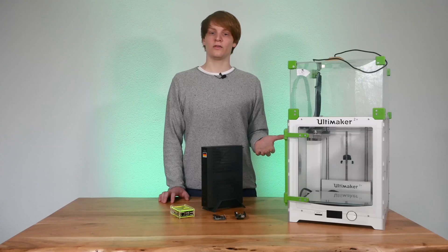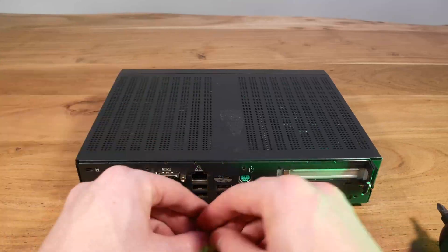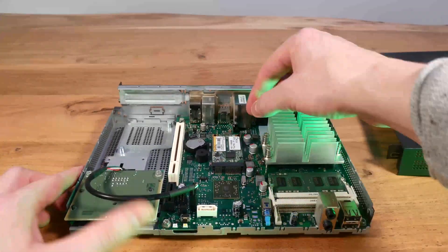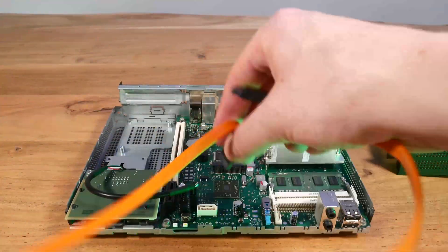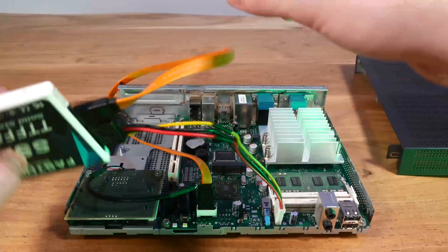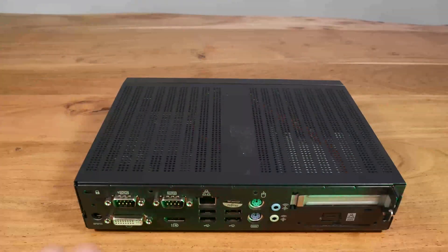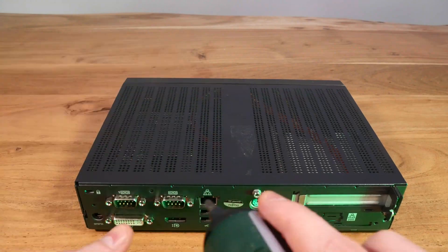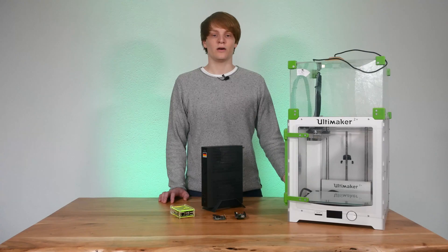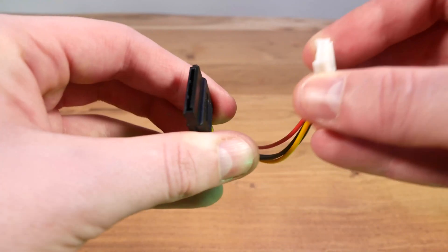How do you set this up? First, I needed to replace the mSATA SSD of the thin client since 2GB is not enough to house the operating system and the extra software we are going to install. You can either replace the mSATA SSD with a larger one, or since the main board has an extra SATA port and power connector, hook up a 2.5-inch or even 3.5-inch drive. I chose the second option and went with a 32GB SSD. Worthy of note is that the power connector is a 4-pin floppy power connector and you need an adapter for SATA drives, so I just made my own with some old cables.